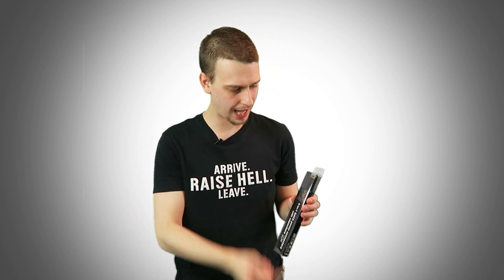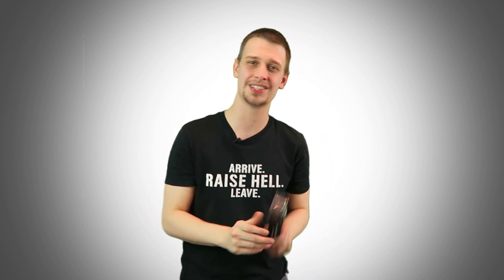Do you have to go out and buy a new power supply to power all your stuff? Luckily, no. There are several companies that make SATA splitters like this one. This is a one-to-four port splitter from Silverstone — the one I use in my own personal home server. This particular one has extra capacitors in the connection end, which means if there is a problem, a power surge, or something fries, the cable dies and not your hardware. A link for this one is in the video description below, but a quick search will find you others by other brands if you prefer.